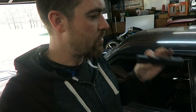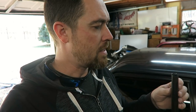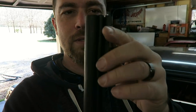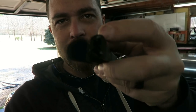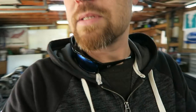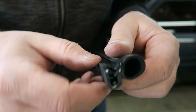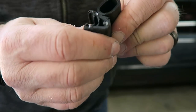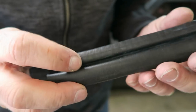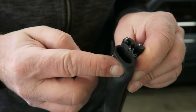If you plan to replace the molding on your Fox — or really any car — I recommend you get the factory-style door moldings. It looks like this one has a U-shaped plastic piece. You can see it's got this factory-style U-shaped piece on this side that's got some steel in there — it's steel reinforced, pretty substantial — and then the outside is what actually cushions the door.